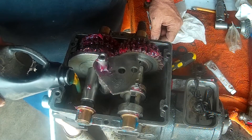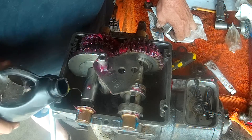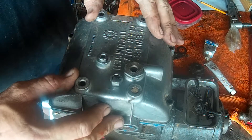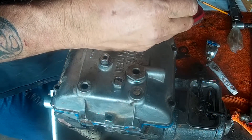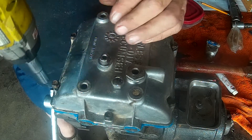Get your good 80 or 90 weight gear oil to put in there. I go a quarter of the way up the gear. We've got it siliconed up. These bolts — I just snug them down with my impact.